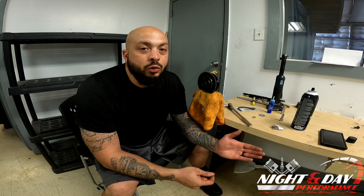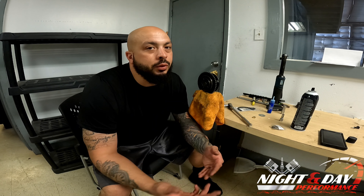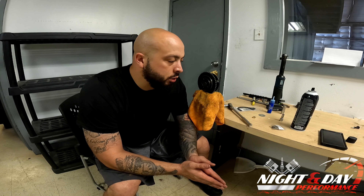For those that work on Hemis and Chevys, you'll notice there's a little difference in the terminology. Hemis either say it's a lockout or a limiter. The Chevy guys tend to say that it's either a zero degree limiter, which means it's a lockout, or a four degree limiter, which means it's a limiter. It can get kind of confusing, so make sure you know the difference between those two.